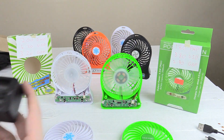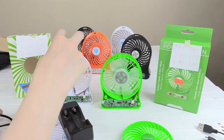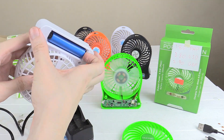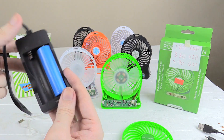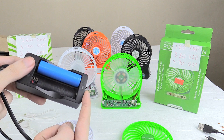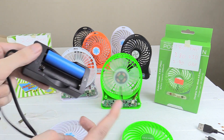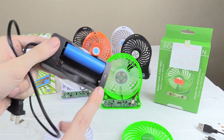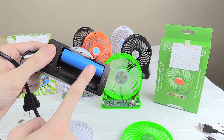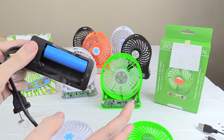If you're not happy with the charge speed, you can actually buy an external AC charger which can charge them much faster. You simply take the battery out, put it into the AC charger, and plug it into the wall. This one is a 1 amp charger, so it would charge the battery twice as fast as inside the fan. You can also buy extra batteries — they're very cheap. People often recover these from old laptop batteries and sell them as recycled, so they're very plentiful.